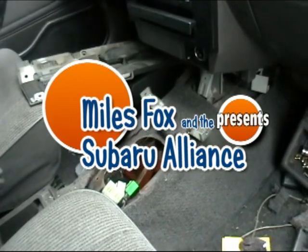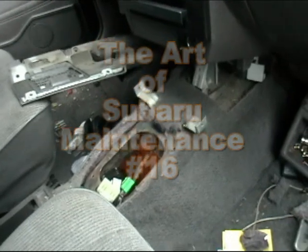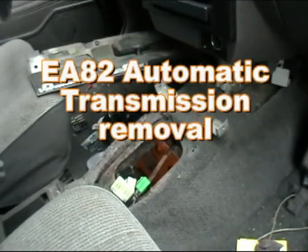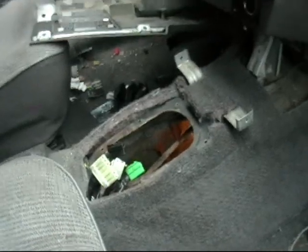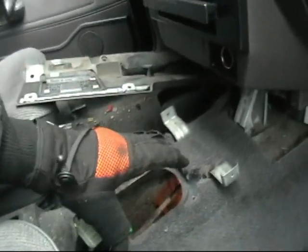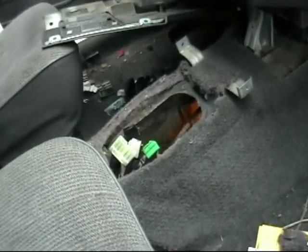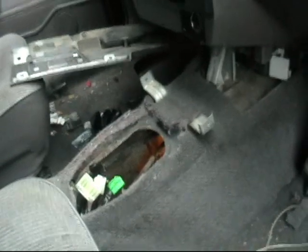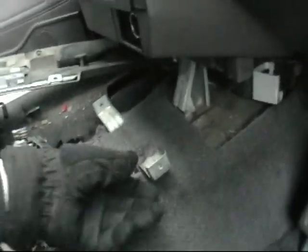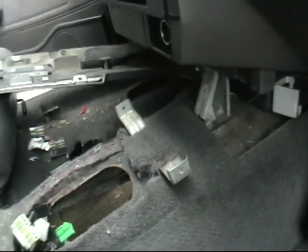It's the next day, day two of our five-speed swap in our 92 Legacy. With the interior piece here, this Legacy having the automatic seat belts and this high-rise center console also had a two-piece console with the shifter console and the little cubby hole. With our five-speed and our cover plate, we're going to go with the single-piece console out of the 89 GL, and this bracket had to be swapped over to have the continuous console piece to match our shifter.